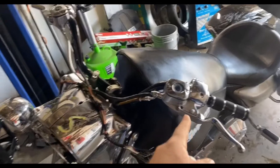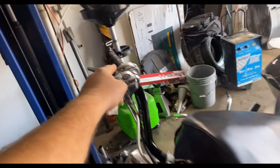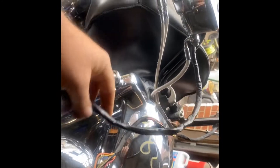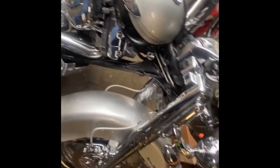I did not do a time-lapse — I had a bunch of things going on with the shop. We got a new table in — new used table, new to us. I got the controls where I want them. I've got to take the throttle grip back off and put one of the little brass pieces on because I lost it and then I found it. Then finish putting the pins back on, put that together, loom it later, put the headlight on so we can actually go for a real test drive. I did all the brake fluids and clutch fluids and stuff. The right-hand side switches are done — got them re-pinned, put in there, wrapped up nice and tight. My loom hasn't come in yet because I'm creating an account with a vendor. Got it wrapped up with electrical tape. Time to do the left-hand side switches — the gray Deutsch connectors — and then we're about 90 percent back together, boys and girls.